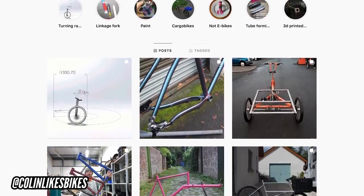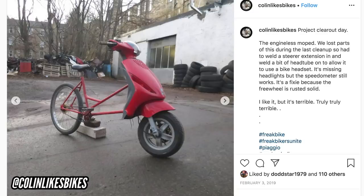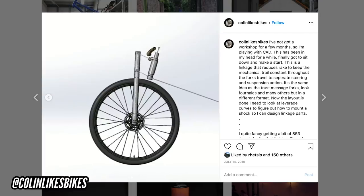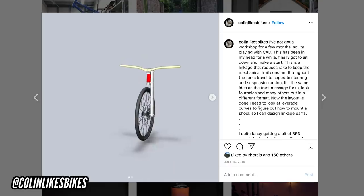On the other end of the spectrum there's a guy — Colin Likes Bikes. What drew me to his Instagram initially was this cut-and-shut scooter and bike: a single-speed rear end of a bike and the front end of a scooter. It kind of reminds me of Colin Furze — a mad workshop sort of thing — but this guy just does bikes. He's also been working on a linkage fork, and you can see a little animation on screen. He's developed a linkage fork with anti-dive properties and constant trail geometry, similar to truss linkage forks. He's even mentioned wanting to make it a single leg using Reynolds tubing. We're putting a link below — we might even go visit him, watch this space. Hi Colin, if you're watching.